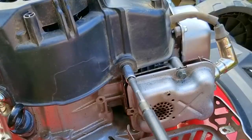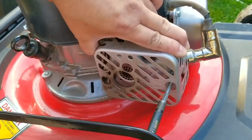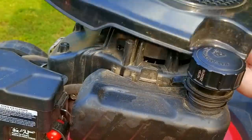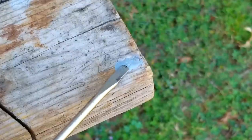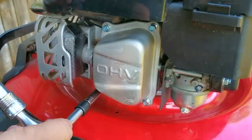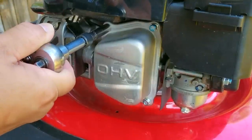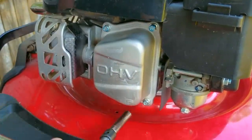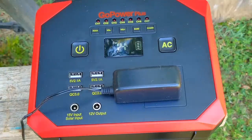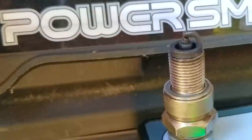It's also been several hours since resealing the valve cover, so I want to check on the sample button of gasket maker I made. I didn't want it to completely set up — only a bit tacky with a lot of body — so it wouldn't get squished out of the mating surface by torquing the bolts down while still soft. It's got some body to it so it's safe to tighten the bolts. To test the spark plug I'm going to use my tester from a mega online store, powered by a tiny portable power station. I don't change plugs unless they have an issue with them.